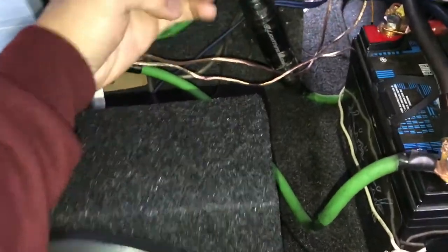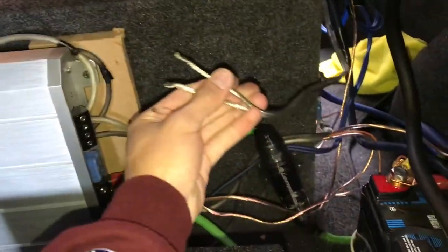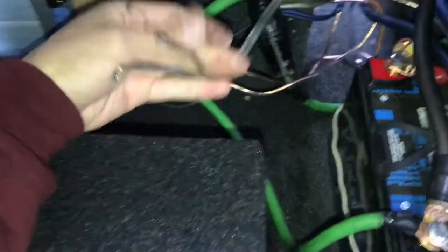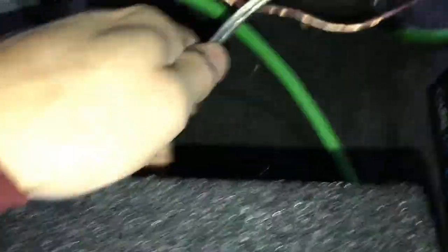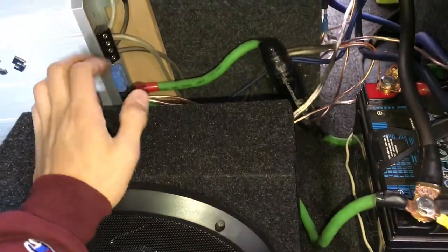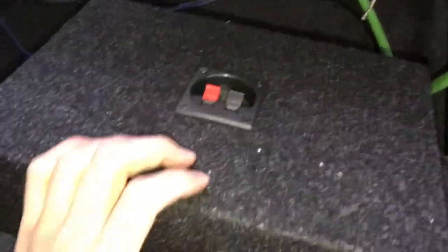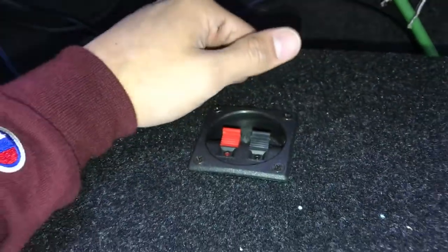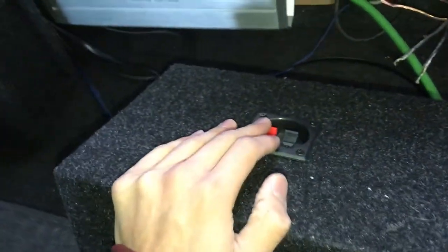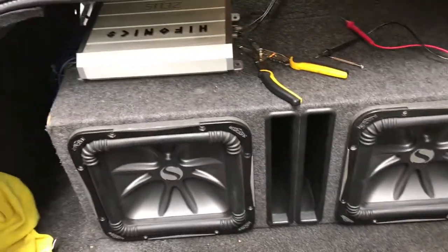I ran into a little problem. When I had my little tweeter pod connected I only had a remaining short wire, so I connected it right there — it just barely gave. It's going to be a little tight, as you can see it barely reaches. I'll push this back and make the best of it for now until I go get wire — I can just go to AutoZone and get some cheap wire. I was able to make the wire fit. I have to take these and split them up. I think I have my wires over here — everything is all ready. I'm going to take my voltmeter and make sure the ohms are correct, make sure the resistance is 4 ohm and they're working properly.